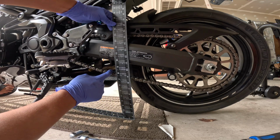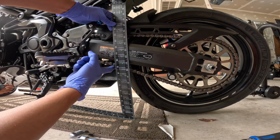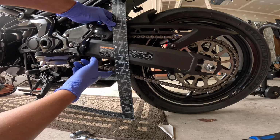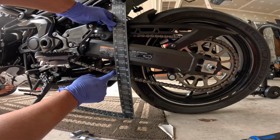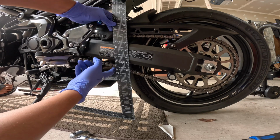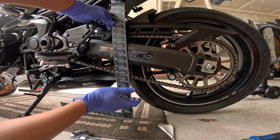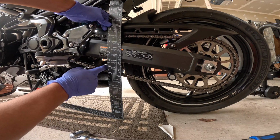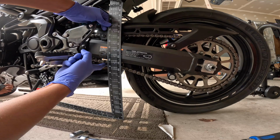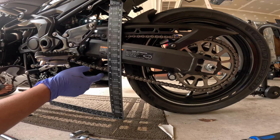So deflecting down a 1/2 inch, but if I'm going up, okay, so I do need to bring it out just a little bit because the maximum deflection should be less than 1.5 inches, a little bit. Let me see, check in the middle a little bit. Deflecting down a 1/2 inch, going up a whole inch. Yeah, so hopefully that shows on the camera.